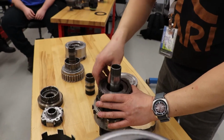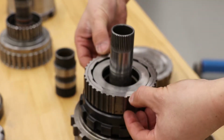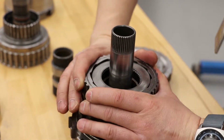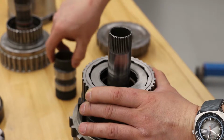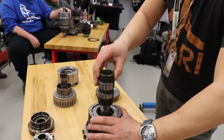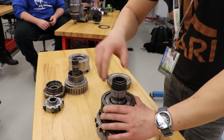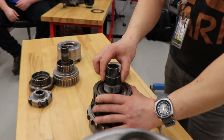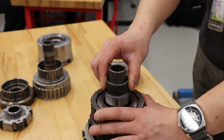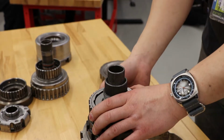With the addition of the one-way clutch, which is inside the rear reactionary carrier, you're getting additional holding force from these clutch plates, which will hold the rear reactionary carrier stationary. Now, if you were to go backwards, torque so far up to this point is going into the common sun. So effectively, like I said, the front planetary unit is not even in the equation. Essentially, you have a simple single planetary gear set. Whenever you hold the carrier, you will have a change in direction. Am I right? Input, held, and in this case, the output will be the rear ring.